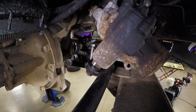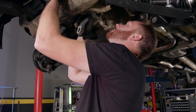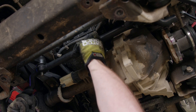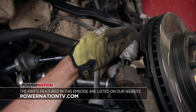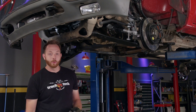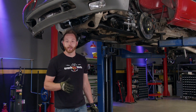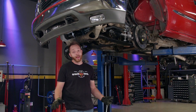Depending on what kind of truck you have, you may also need to remove other components to gain access to what you're working on. It's a breeze to reinstall the new parts because they are direct replacements for the old. To get the wheels relatively straight, I set the length of the new tie rods as close as I could to the old ones. As much as you may dislike doing basic maintenance work like steering and suspension, there's nothing that's going to improve how a 20-year-old truck drives more than a freshly rebuilt front suspension aligned to factory specs. I still need to get the GMC dropped off at the alignment shop, but other than that, we're ready for the big tires.